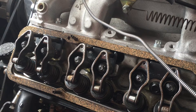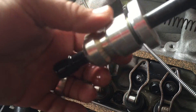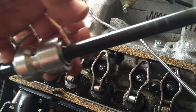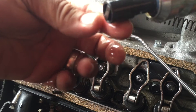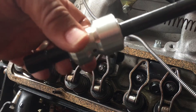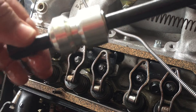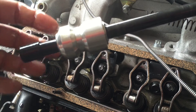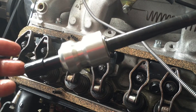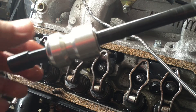Here's what we have. This piece here catches the oil galley, and it basically just slides up and covers to keep any dirt or debris from falling down into the engine. At the bottom there's a slot that catches the oil pump down in the oil pan. This catches the oil galley and makes sure oil gets everywhere. They sell two versions — one without this galley catcher where you can just spin it up, but you're not truly getting all the air out. It's better to buy this tool — about $17 locally at a speed shop, but well worth the investment for priming a new motor.